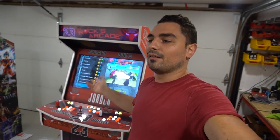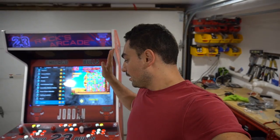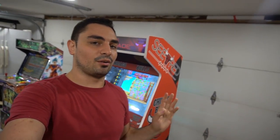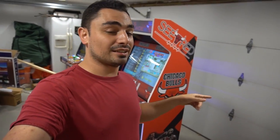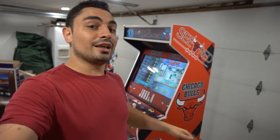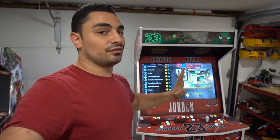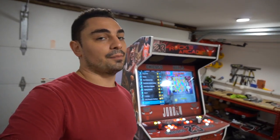There are a couple of pluses and minuses when it comes to smart TV. It is smart TV compatible now, so you can do Netflix and all that. The only downside is that the TV does not turn on once you give it power. Basically, when you plug the TV in, it asks if you want to keep it in store mode. If you keep it in store mode, it does power on once you plug it in. If you switch it to home use, that feature is no longer available - once you put it into home mode, it will no longer automatically power on.